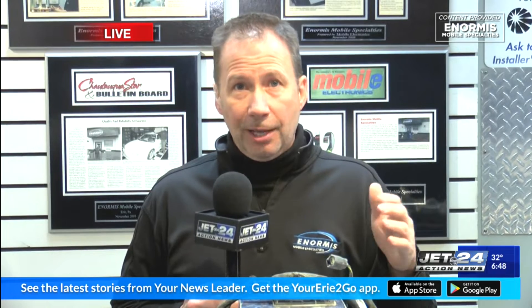Because of these failing — and they're failing with cars that are 2016, 2017, 2018 — some of these cars are coming in with 50,000 miles on them. In my opinion, that's not a lot of miles to have things like this failing. So some car manufacturers have actually increased the warranty on these items. Normally, a car will have a three-year, 36,000 bumper-to-bumper. However, some car manufacturers have said we're going to give you six years, 60,000 miles on these blind spot modules. And some people are coming in at 70,000 or 80,000 miles and have to pay for it. These are not cheap to replace.